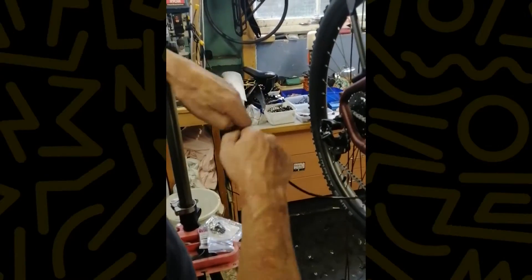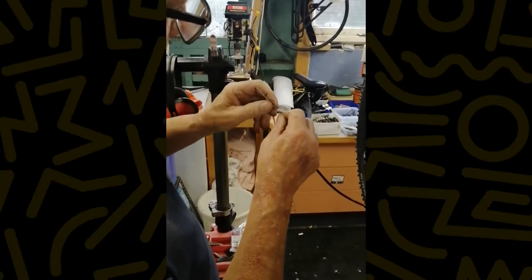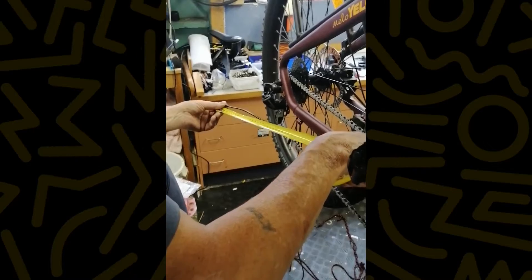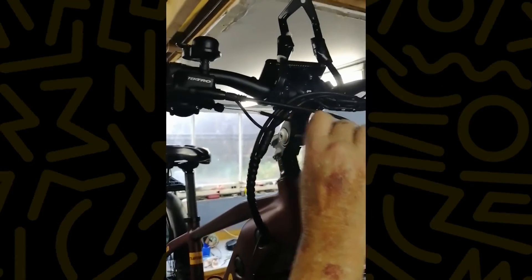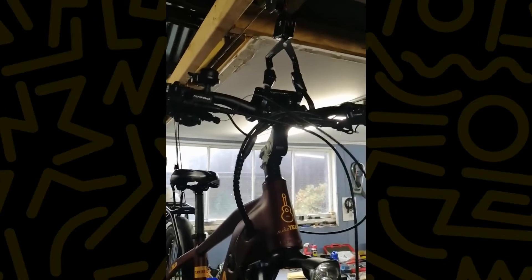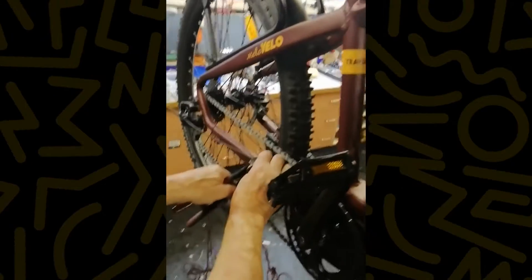You can pull the end barrel off if you want — get that out of the way. Any kinks in the wire, just try and straighten them out a little bit because that will help. We're going to put our sensor in there, so we want to cut the cable at about 420mm. Now go to the top where the gear cable comes into the changer, pull that back and pull that cable through about 500mm of the inner cable. Don't pull it all the way out because then you just create more problems. Go to the place you're going to cut and put your sensor, and make sure you've pulled the cable back far enough.